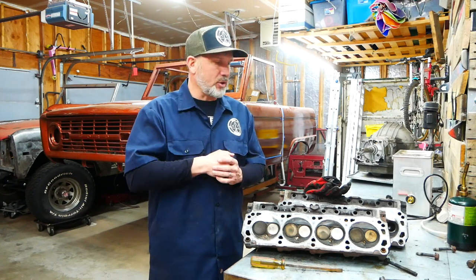It's more than just the welding part that helped us out here. We actually pre-soaked the bolts from the backside, and then we shocked the bolts with heat and cold water. So we soaked the bolts with penetrant from the backside, shocked the bolts several times using a welder and water, heated the hole from the backside using a torch, then shocked the bolt one more time right before we extracted it. We also welded an old screwdriver to the bolt to get the angle we wanted without hitting the head. We did it with both bolts — both bolts I cut a notch into and tried to get them out with heat and a big screwdriver, but it kept breaking the ears off. It broke those ears off almost immediately, making the bolt shorter and shorter, until finally we only had just a tiny bit left. But we got them both out.